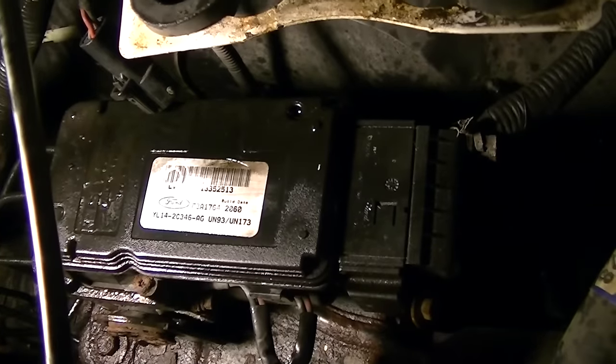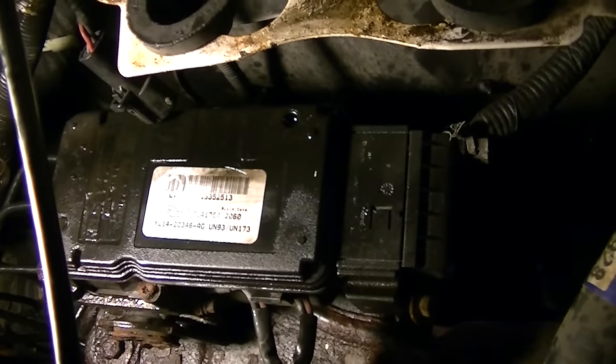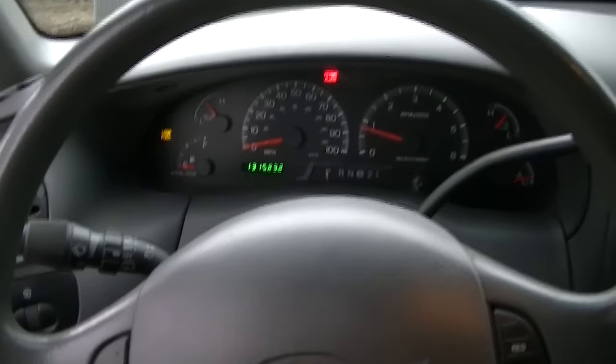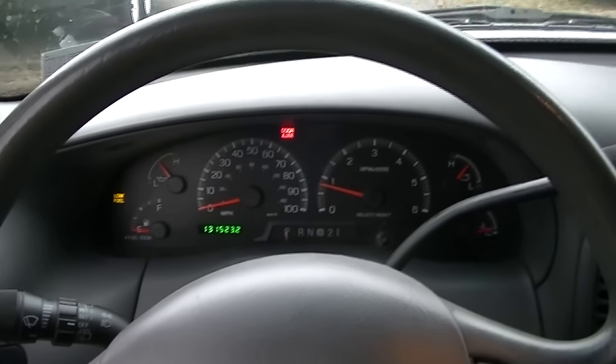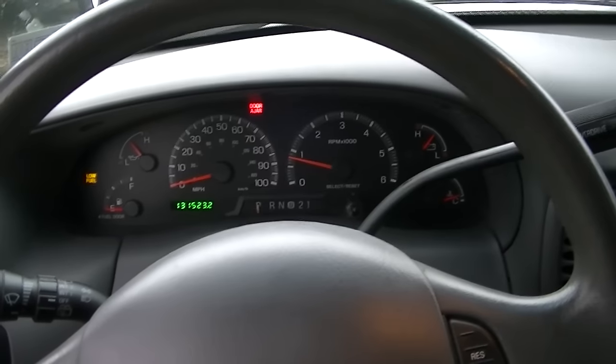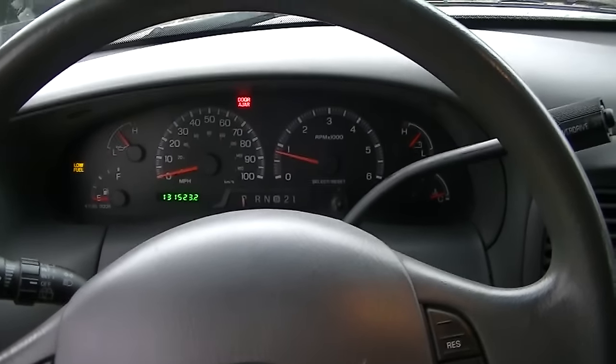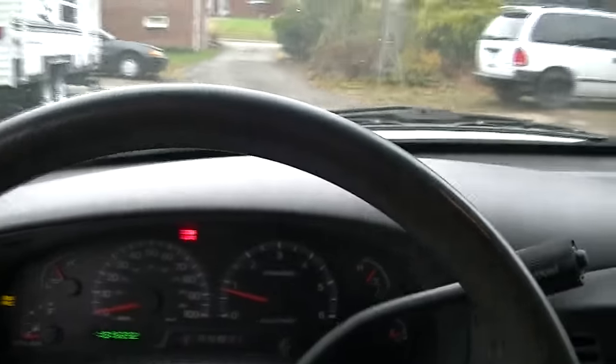Like I said, I've never had to replace one of these in my life working on cars. I've heard other people have, but it's very rare that they get replaced — apparently I picked up one that needs to be replaced. I found one at a local junkyard for about $40 and I want to go make sure it's got the same part number. I did take it around the block one more time, pumped the brakes, put fluid in it, and you can see as I put my foot on the brake it just slowly continues going all the way down to the floor.